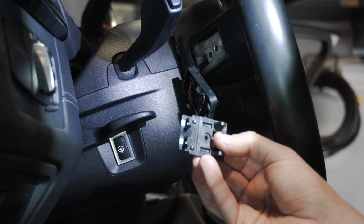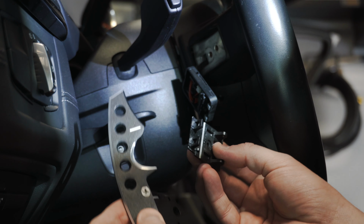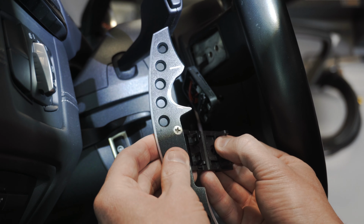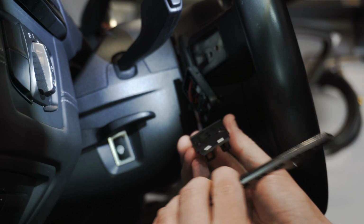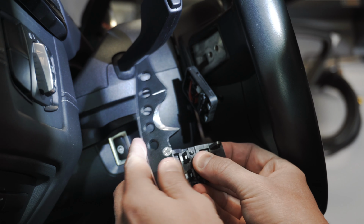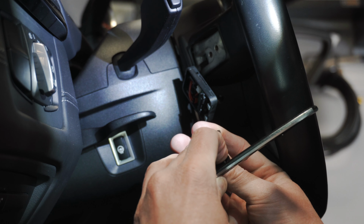All right, so with that black plastic sleeve that we just removed from the old paddle shifter and our new awesome paddle shifter, those retaining clips are gonna go into these little two holes, so we're just gonna simply slide that back and line it up. You'll see a little cutout circle there that is gonna have to go through that. And it's gonna go in these sleeves. So just reverse order, making sure it gets lined up with that hole there.